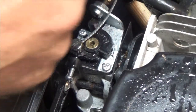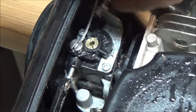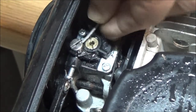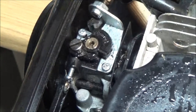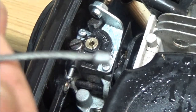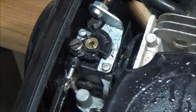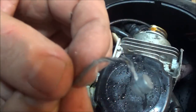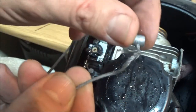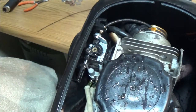I've already pulled this part out of the sleeve yesterday. This is just going to slide back like that — and there's what the little tiny end looks like. I've got a cable here that came off of a scooter, and this was the issue with it — see how it was starting to fray. So I'm going to try to cut this cable down and maybe make a couple of these ends out of solder or something.